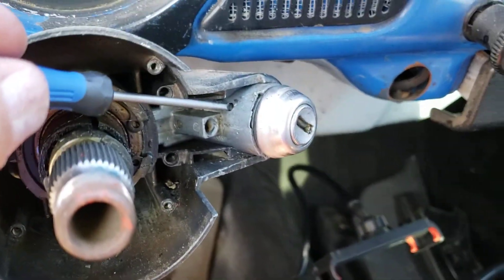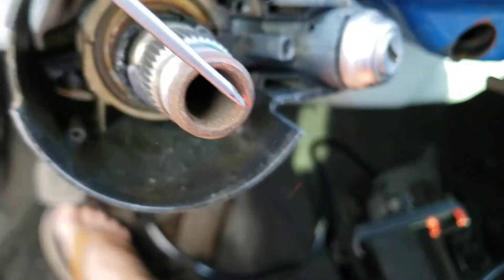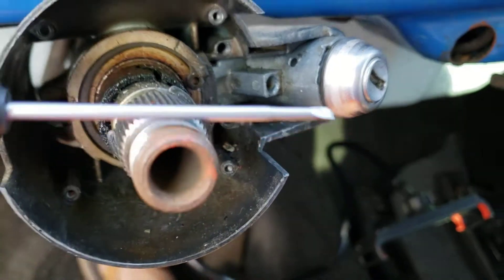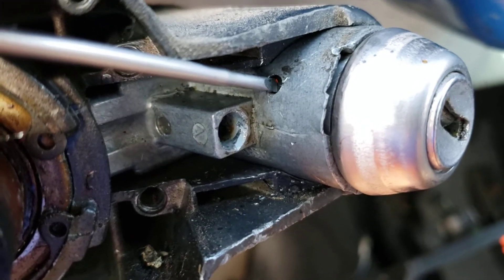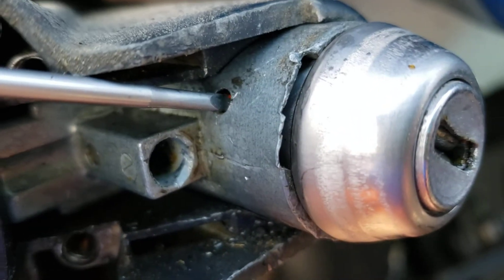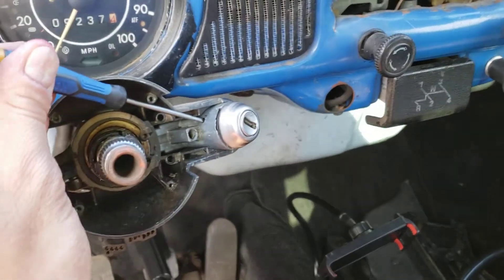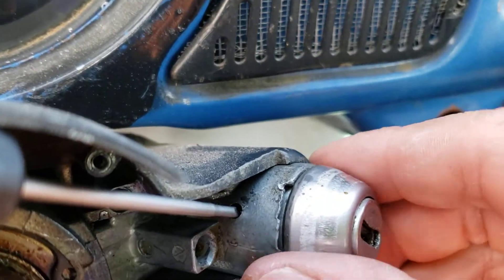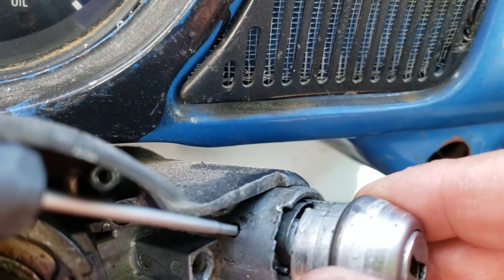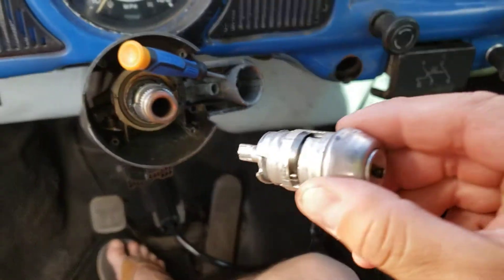- your key ignition lock switch, or whatever you want to call it. There's a tiny hole right here and you just got to put a little bit of pressure on it, so I'm just gonna use the same flathead. You put it right in there and see that little bit of movement - that's all it is. Press it in and then pull this out. I lightly pull it out and there you go, just press down and wiggle it back and forth to pull it out, easy as pie.